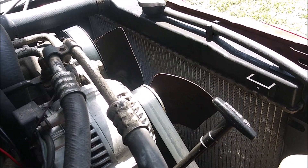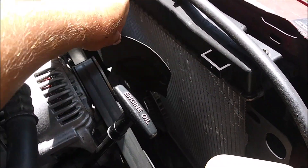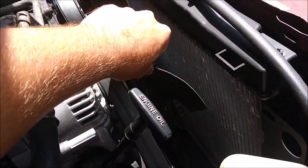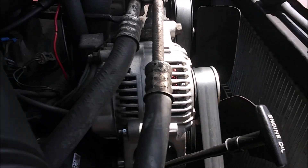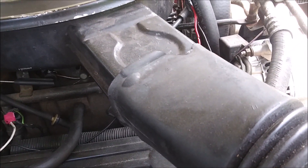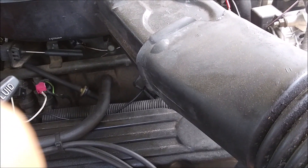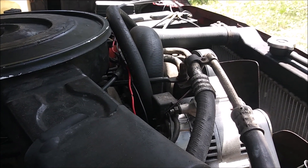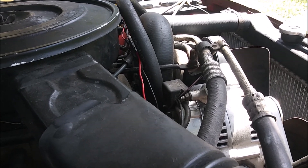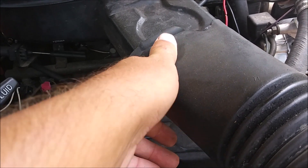The radiator is exactly the same, but I don't have a fan shroud on it because the V6 fan shroud won't fit — it stops right here. Water pumps are the same. The top radiator hose will have to be shortened up a little bit. I ran into that issue. I'm using the stock V6 air cleaner, which may or may not be ideal, but I haven't had any issues with it.